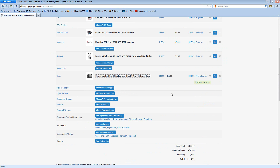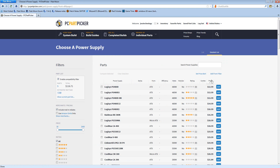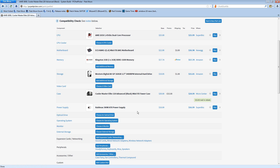The last thing we need is a power supply. We're not going to go with the absolute lowest price — if you look up the Logisys power supply units you may see some really angry remarks. A lot of people have complained they're very cheaply made with really cheap wires. The RAIDMAX, on the other hand, I do have experience with — they're inexpensive but better made overall, and the reviewers seem to agree. So a RAIDMAX 380K should be just fine. Our total draw should be only around 72 watts according to PCPartPicker's estimate, so with 380 watts we should be just fine with this ATX power supply.